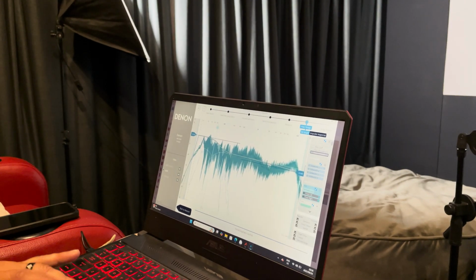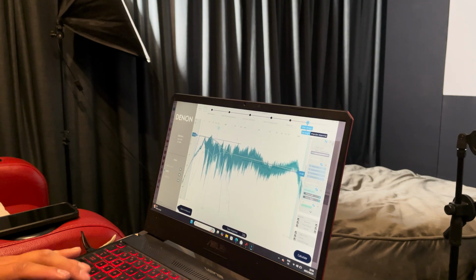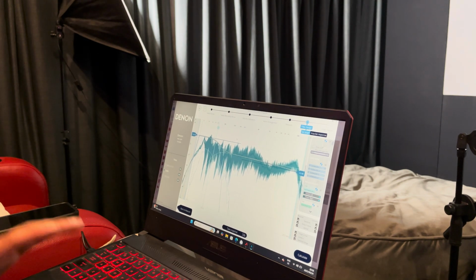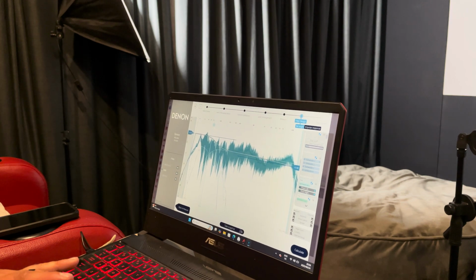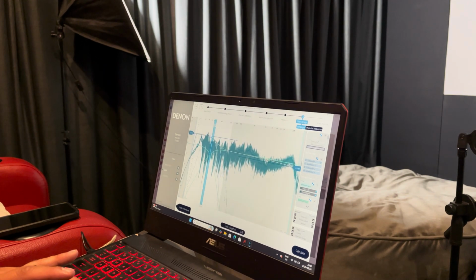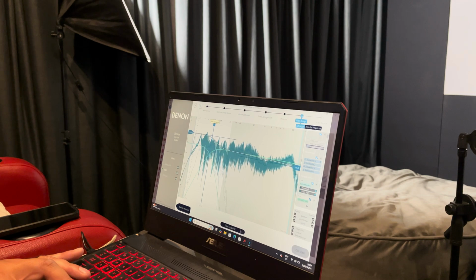Okay, so basically run a 10 dB curve on the speakers where you want. So for me, front speakers, surround speakers, I'm not going to do the ceiling speakers because I don't want that amount of bass through them, as I have explained. So this is front, left and right. I have a 10 dB boost. We have the crossover set to 70. I will move this crossover to 80.